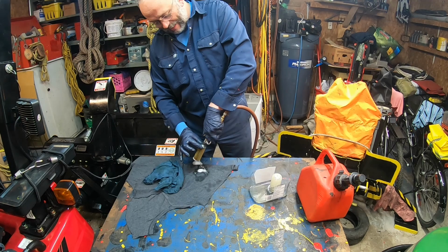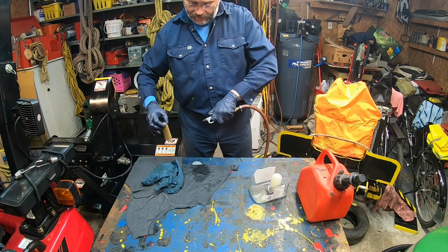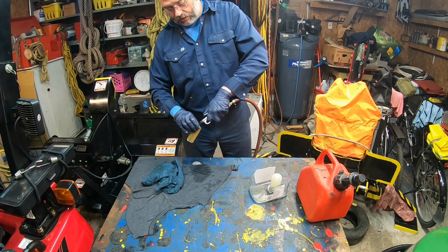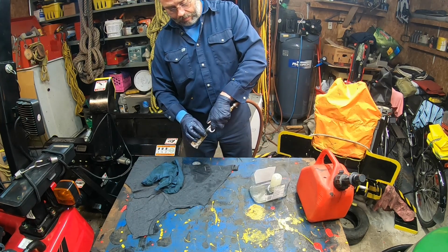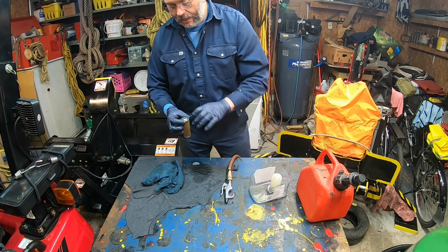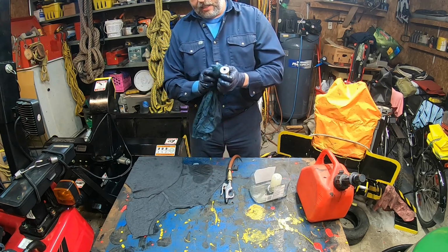Look at that. Very light pressure. And then again, and then a little bit. And make sure the blast is pushing towards the bottom of the filter. You can also put your finger to hold it in place if needed. And look at that, it's all right. So all the dust is going away. Then with a clean rag, just wipe off all around.